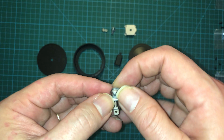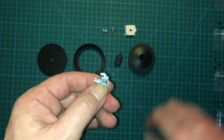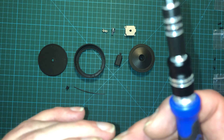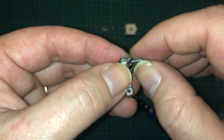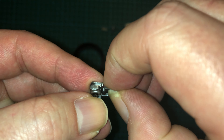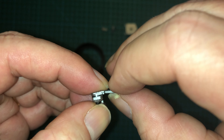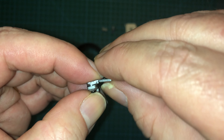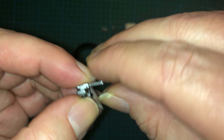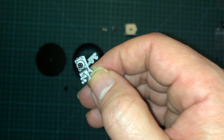We use a BP screw to hold it all together, nice and tight. Then we're going to take the fast idle cam itself — it is also keyed right there — go right in there, just like that. This time we're going to use an EP screw to hold this together. Be very careful; I put a little too much pressure on this trying to get it all together. This is a little off, so I may have to glue it back on. That's about as good as it's going to get.